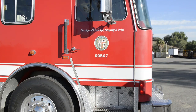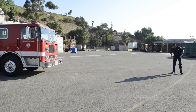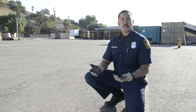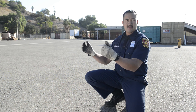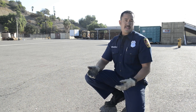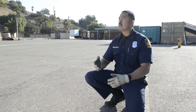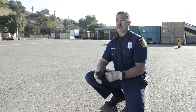Let's get started on this DMV pre-trip. You're going to come to a vantage point where you can actually see underneath the rig. You're going to take a look at the overall appearance of your rig — is there anything obviously hanging off? Is it leaning to one side or the other, indicating maybe a suspension problem? Then look at your ground: is there anything on the ground — puddles, leaks, bolts, hangers, belts, cables? Then look — is there anything hanging underneath the rig that's not supposed to be there? Again, bolts, hangers, belts, cables.